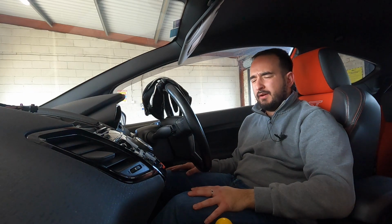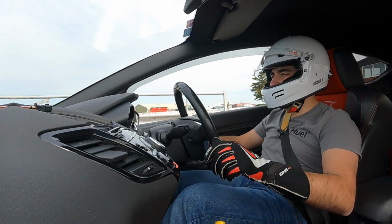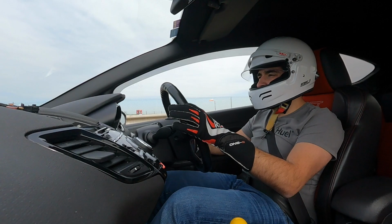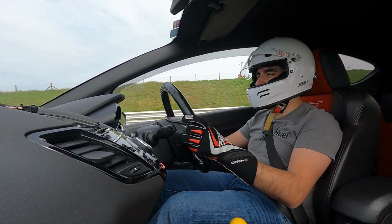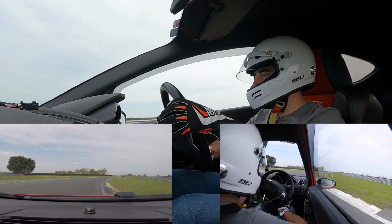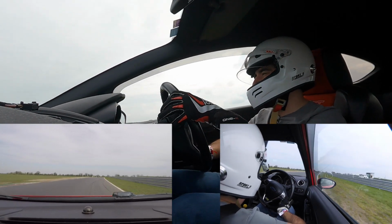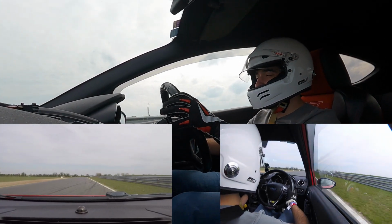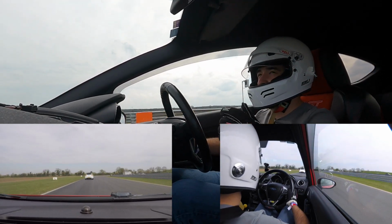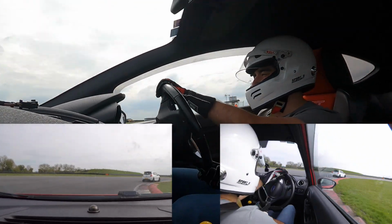Now I'm going to have a cool down again, check the pressures, and I'll update you with them in the second session. All right, second but technically third session of the day. Now, tyre pressures again: when I came in from the session that I filmed, they were 36 all round again, so they've been pretty consistent, the tyres as well. And when I did my session off camera, again I brought them down to 32 front, 34 rear, and came in and they're about 36, 37. So yeah, again, consistency has been pretty impressive.